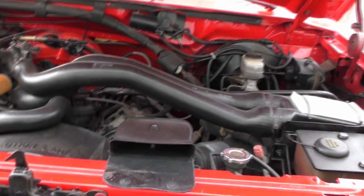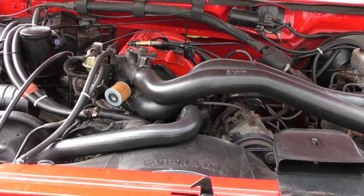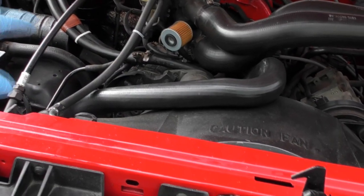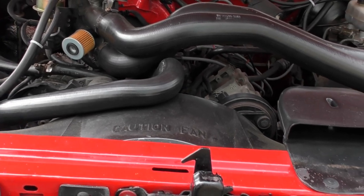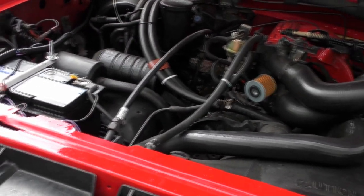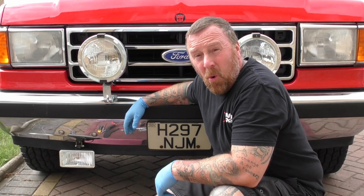A quick look at the engine. I know I've seen it in another video, but let me quickly show you. Pan down, put the bonnet down, and then we're going to see if they all work and what they look like. That is a 302 Windsor 5 litre V8. I drilled seven holes in — didn't want any crap to get in there. And yes, I've got the filter there. Because of this weird carbon barrel thing and all the airing, it just didn't run right — that was just left to suck in air from wherever it wanted to. So I put that on there, it runs a lot better. It starts properly now. I've tucked the wires all the way to the back, and there's a fuse as well. So the bonnet's down — let's have a look at all the lights coming on.